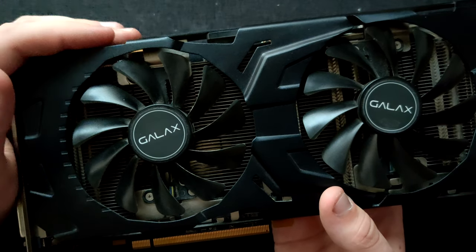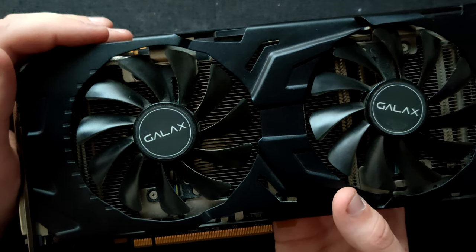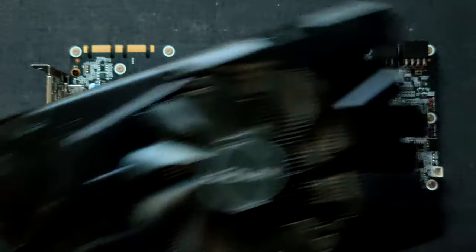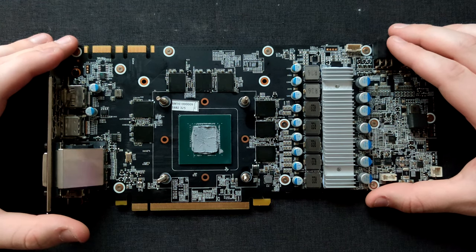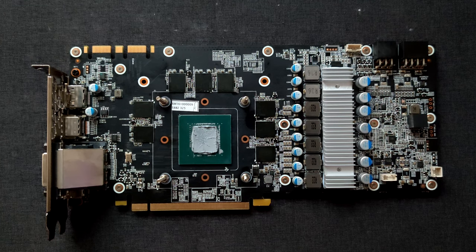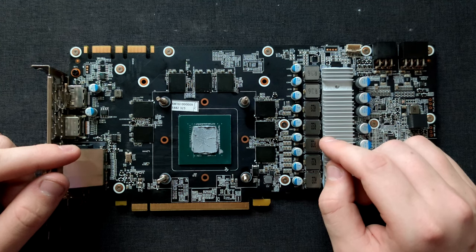If you force the highest voltage power state — I did a video about how to force the highest power state to always be active as long as you have enough power limit — this card does around 2100 to 2115 MHz. Pretty decent clocks, about 100 MHz above where some bad 1070s already max out. Now what does this new card do? It does 2250. I've always known Pascals that do over 2200 exist — I've done 2200 on my 1060, but that needed 1.45 volts. This one does it at stock voltage. 2250 — this has an amazing core.